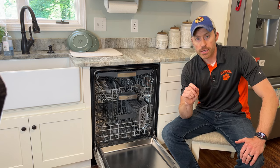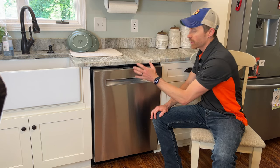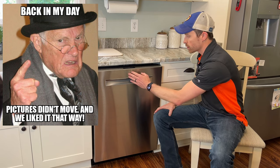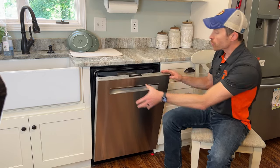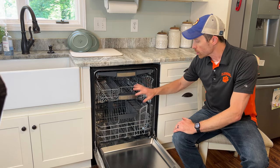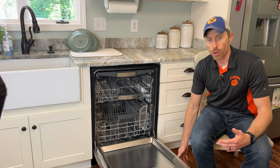The second problem, which I actually think is the biggest issue with this dishwasher, has to do with the door sealing. If you're older than about 35, maybe you remember an old school dishwasher that had a latch where you had to close the door, turn the latch, and get a really secure door seal. Bosch needs to go old school, because this doesn't have anything like that — you just push it closed. You get a little click, but it's telling me the door isn't fully closed, and it senses that this door isn't fully sealed and will stop your dishwasher load.